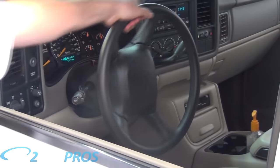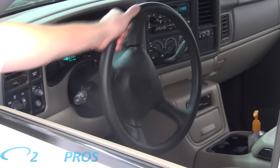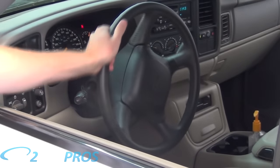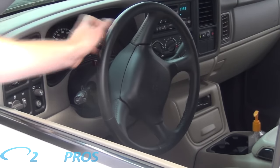It is a good idea to keep an eye on the fluid level over the next couple of days just to make sure it doesn't drop anymore. You might also find that the power steering pump is making some odd noises or the wheel judders a little bit — again, those are the air bubbles making their way throughout the system.